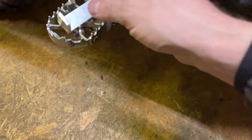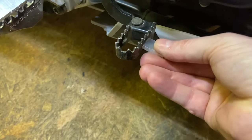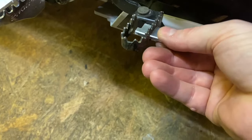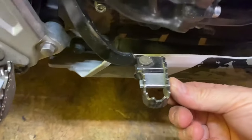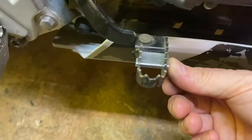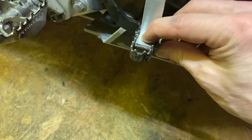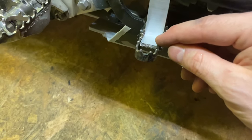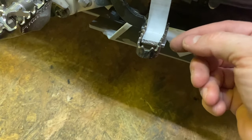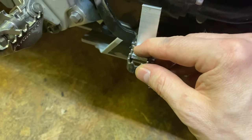We made this little piece here, and we have this piece. The little piece goes in here — should fit, wrong way around — and it sits here and locks in there. I will shorten this up and also trim this side, then this piece drops in like that. Then I will drill a hole through both of these, countersink so I can have a cone head bolt through here with a nut on the other side so they lock in place. Then I'll just decide on the length.